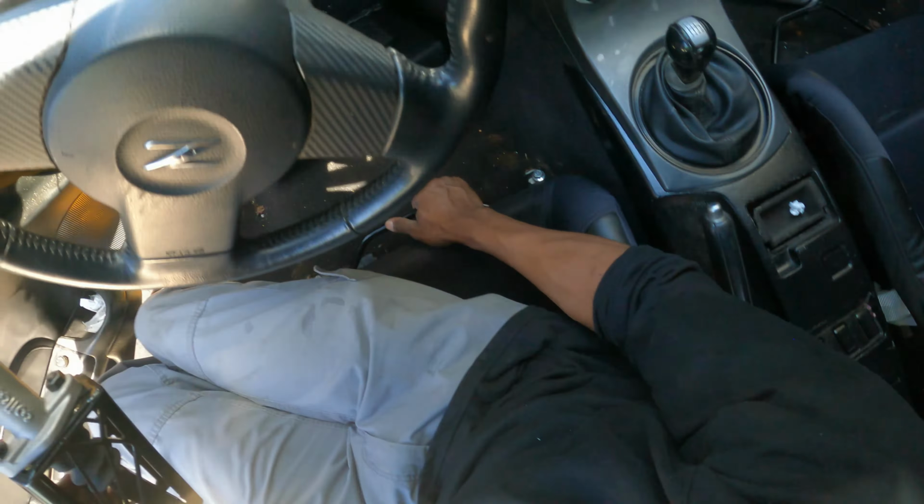So next thing on the agenda, see the steering wheel is kind of locked. We're going to put the key in and center it. And then we're going to take this hub nut off. After that, we want to make sure it's completely centered, because when we put on this hub, you can actually get it wrong and get it, you know, 15 degrees off, probably not 15 degrees, probably 5 degrees off left or right. So you can see on the hub, there's a little black dot right there. That is the top hole. So we want that to be completely straight when the wheels are straight.